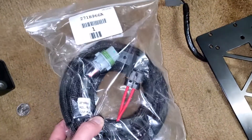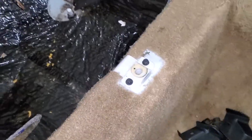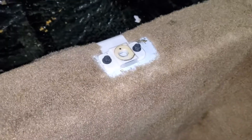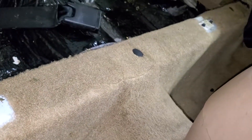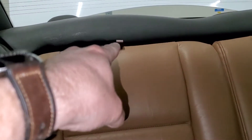To get the power wire from the control module back, I had to remove the back seat. These clips were a little tough — you're supposed to be able to just push the seat belt in to release them, but I didn't really have any luck with that. I used a screwdriver to push them back and was able to get them out, about eight inches or so in, just to the left of that little pole right here.